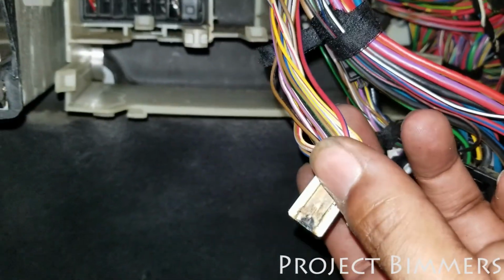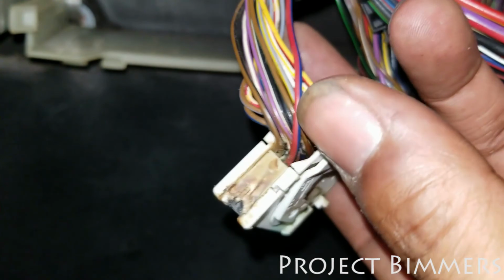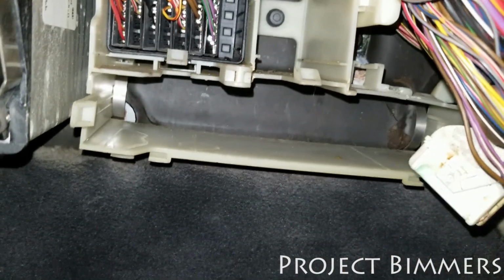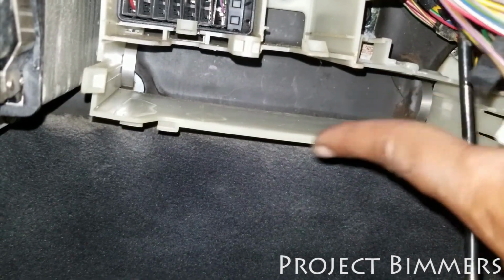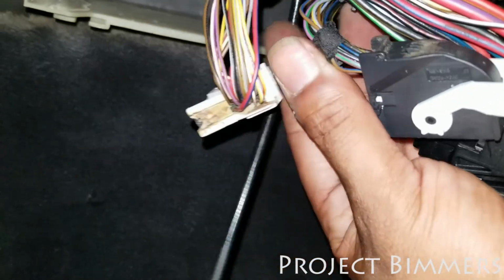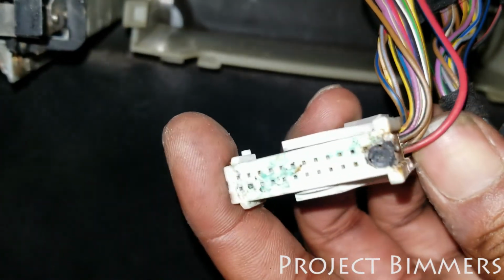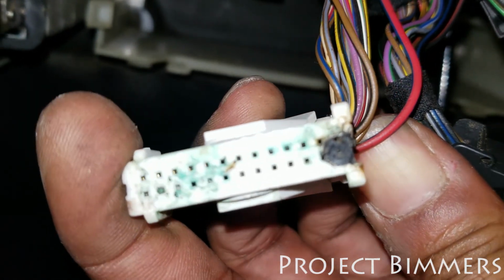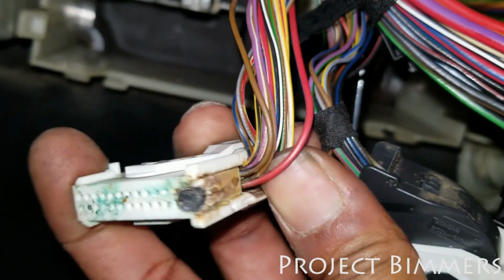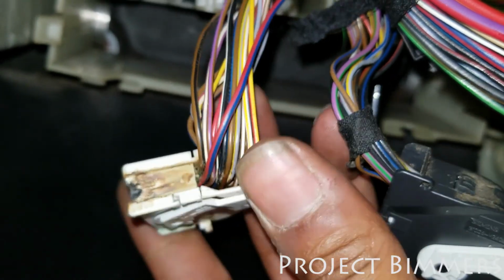Alright, so I was looking at the wiring diagram, and there's some wires that's supposed to be sent from the switch. Looked like the switch was sending the wires, so I went to look under where the general module was. It's under the glove box under here, and there was a module that was right here that I unplugged the harnesses that were in there. Okay, and then this one harness, I noticed this. What the hell is this? This is burned so bad that the pin can't even fit in there anymore. Okay, so that's burnt completely. And then I managed to get the module out.